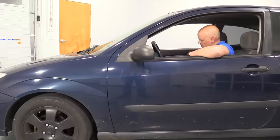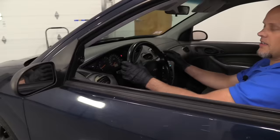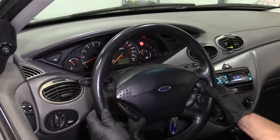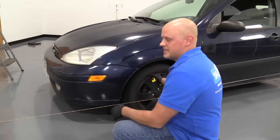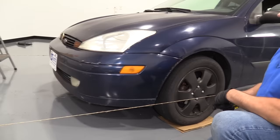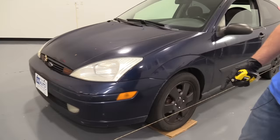I'll set those right there and do the same for the other side. Just going to back the car up a little bit so it's centered on the cardboard, and I'm going to take the steering wheel and go back and forth with it, trying to get it as close to center as possible. Then shut the vehicle off. So we took a piece of string and wrapped it between two step stools — you could use a milk crate or a jack stand. We want them fairly far apart, about arm's distance from the tire, with the string at about the center height of the tire.